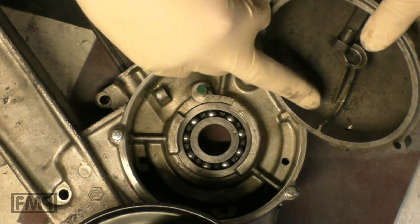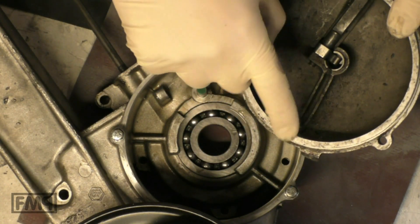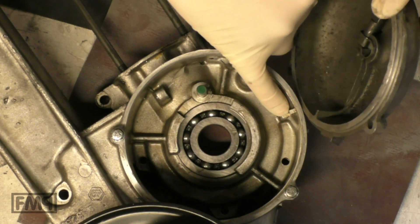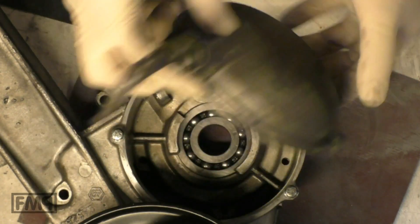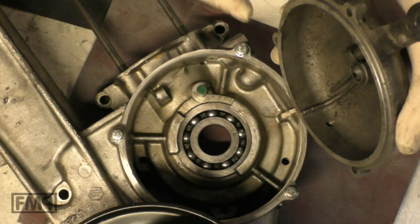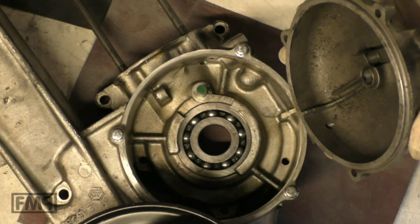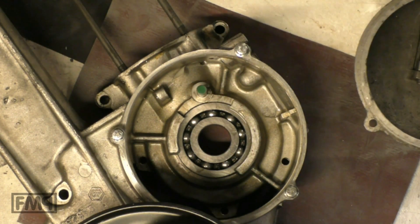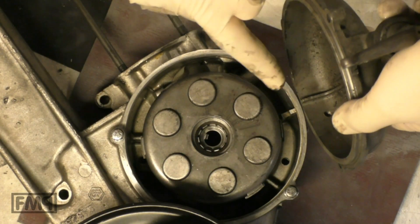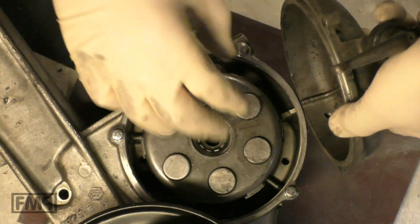If you have a look at the beams — we know this one — this is a 125, because this beam here is bigger. This wall, this small wall — they belong to each other. So if you put the clutch lid on, you kind of have a wall here up till this rounding, to guide the oil towards the push rod. And as the clutches did get bigger, this idea of bringing oil here on the push rod and the pressure plate just disappeared, because the clutch got bigger.